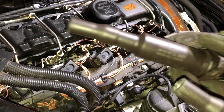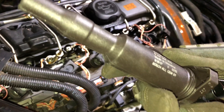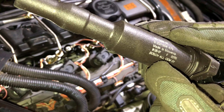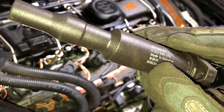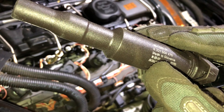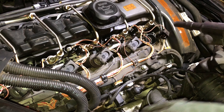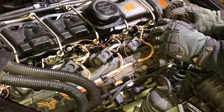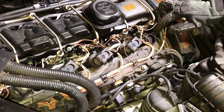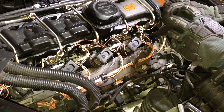This is the new plug we're going to be putting in — these ones are Bosch original manufacturer, tripod on the bottom, no gap needed; they come ready. The nice thing is the socket is magnetic so you can just drop it in there and it's not going to fall out. Thread it in by hand first, because you don't want to cross-thread this type of stuff. If it takes a lot of effort you're probably doing it wrong, so get it set in there before you start wrenching.